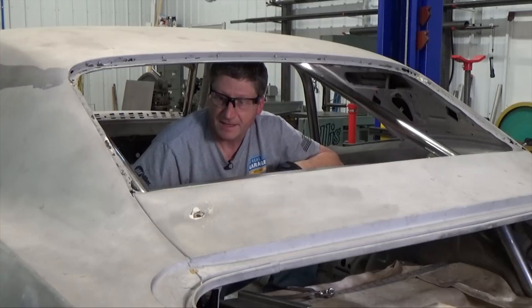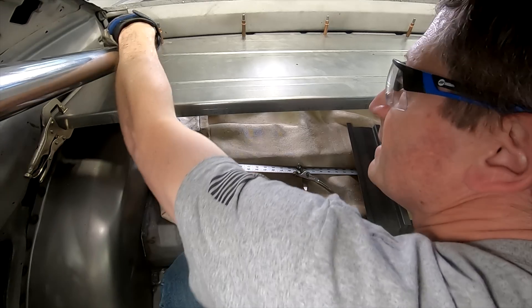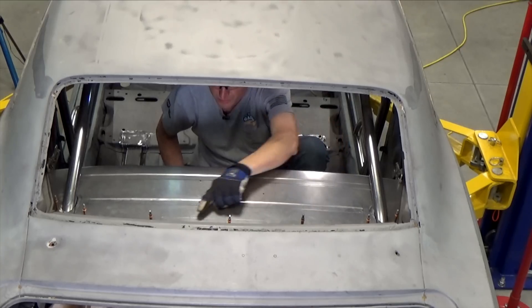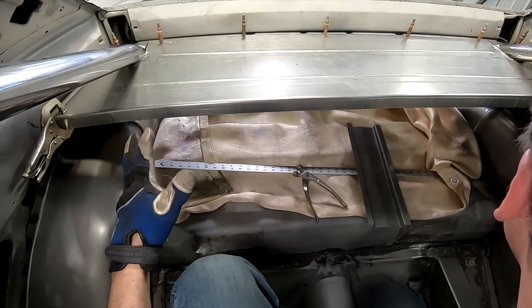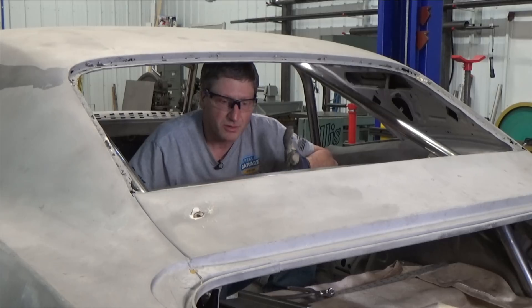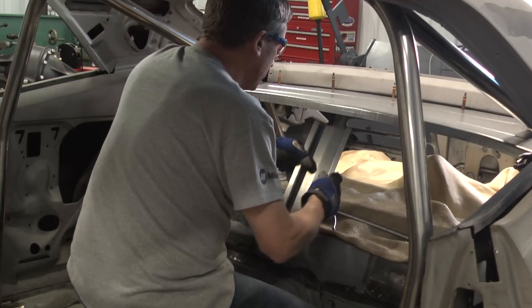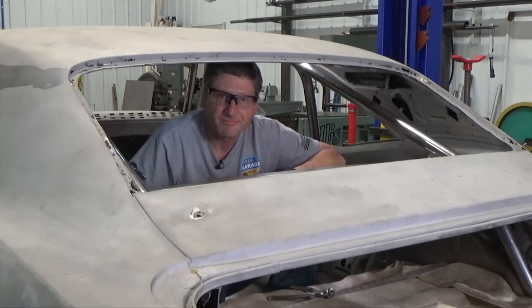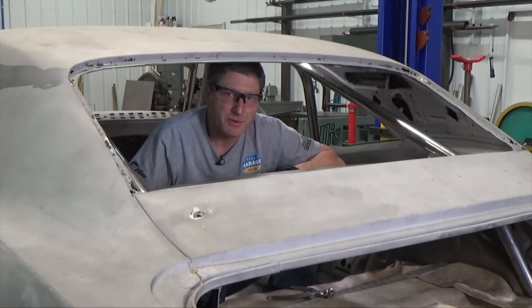The hard part's done — I've got my top panel in, the bead rolls stiffen it up real nice, and my cutouts for the roll bars fit nice and tight. I'll stitch or spot-tack this in place and then pull the clecos out and plug-weld the holes shut. Next it'll be making a panel to close up this big hole, which should be easy because it's pretty much just going to be a flat sheet — no special bead rolls or anything needed. I did make three supports that will get welded on the backside to strengthen the whole assembly up. Next time on Real Garage we make the rear end track bar mounts on the frame — got to keep my rear end centered.